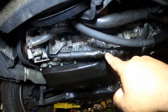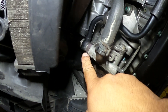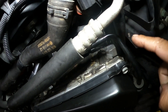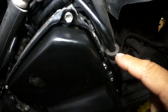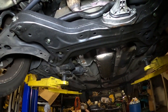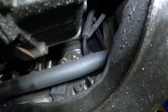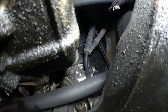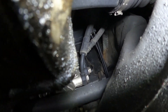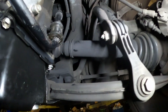Okay, so this is my pressure hose right here and it connects to the power steering pump. I have to remove this bolt right here on top, and it goes on top of the transmission, then to the bottom, and it'll kind of wrap around and connect to the rack and pinion back there. So you have to come on this side — you're not really able to see it, but it's up there. It's going to be the bottom one. There are two right there — I think the top one is the return and the bottom one is going to be the pressure hose, and it has a couple of brackets.